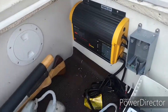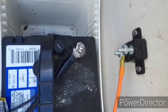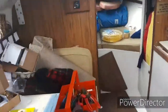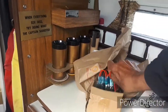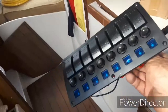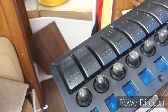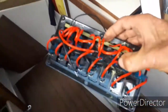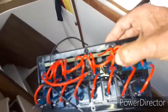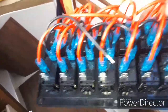There's the charger I put in there, and then we got a 50 amp resettable fuse right there, which is going to feed this new control panel which comes all rewired — it's got breakers and everything. It's got four 10 amp breakers and four 15 amp breakers in it, and it all comes pre-wired on the back. All you've got is hook up your power and your neutral, and spade connectors on the bottom right there to each of your functions.